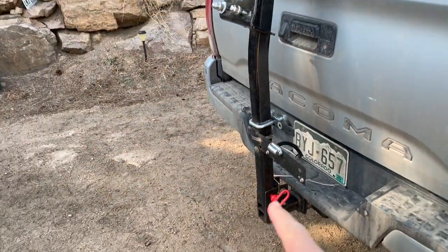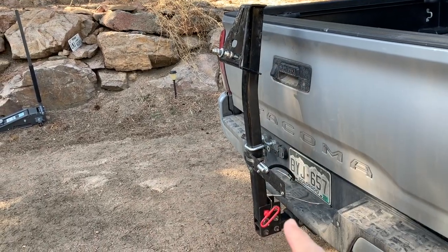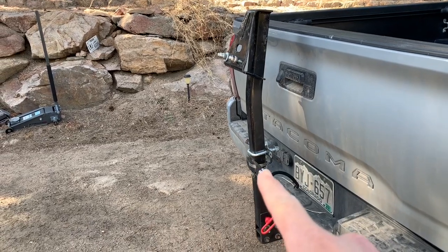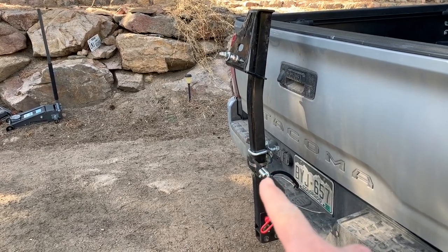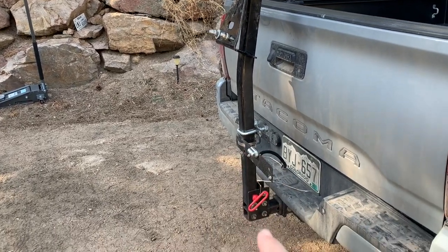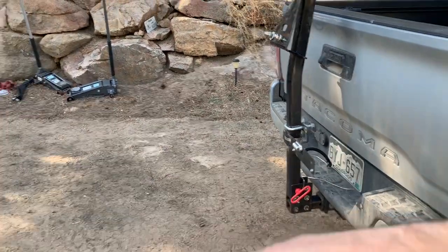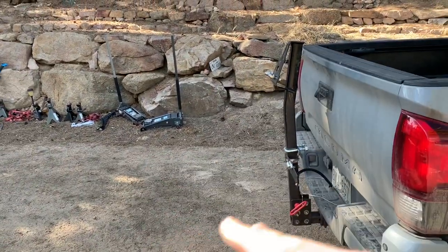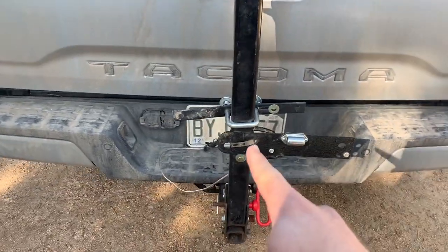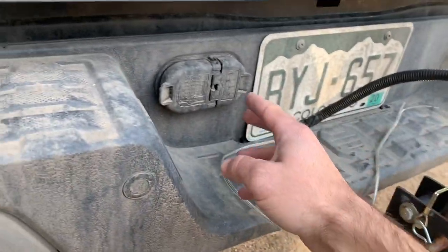I made this out of one of the — I think it was the Draw-Tite hitch. I basically cut it, built this bracket right here, attached it right there, and put square tubing inside, then connected two pieces. If I could weld I would weld the joint, but right now it's perfectly fine because it's all bolted together. This section right here — you pull out this pin and then it lays down as flat as you want, so tailgate use will still be perfectly fine.